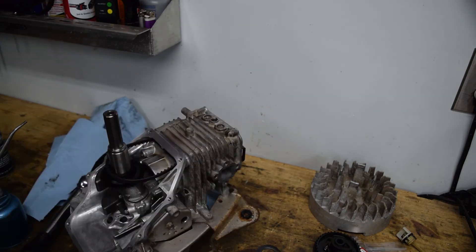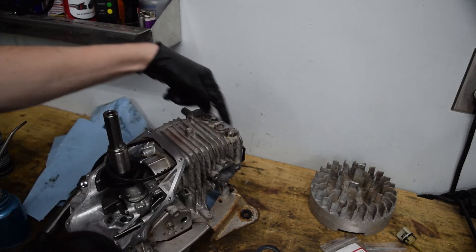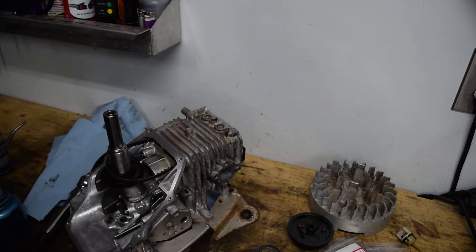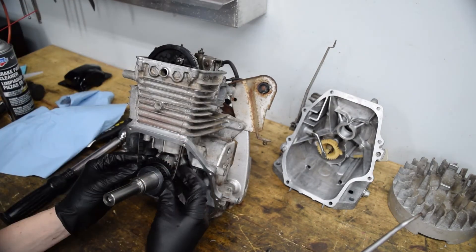On the lobe portion of the crank there's a little arrow, and that needs to be totally in line with the mating surface of the head — that's the proper timing sequence. The little marks are just about lined up. I'm going to slip the timing gear onto the crank.